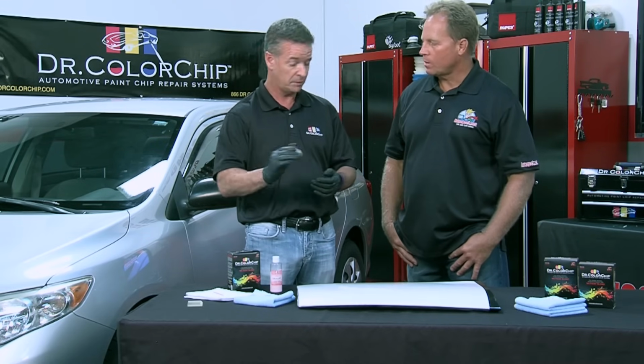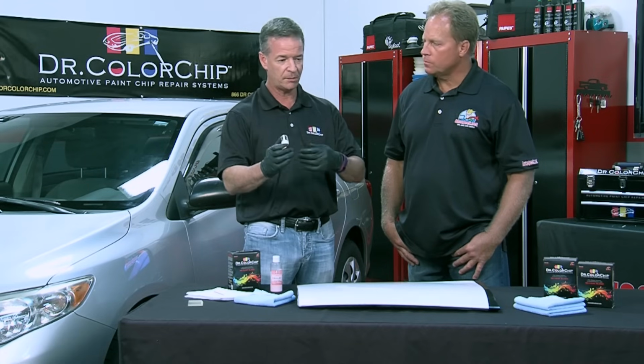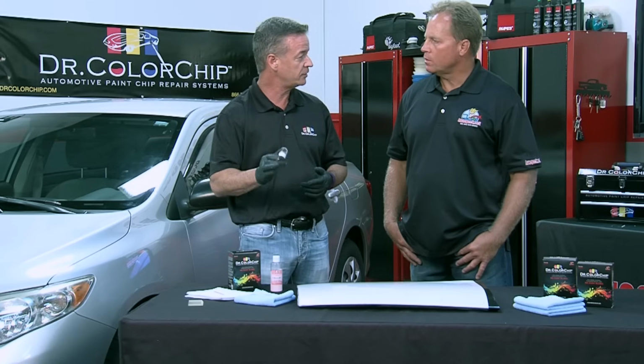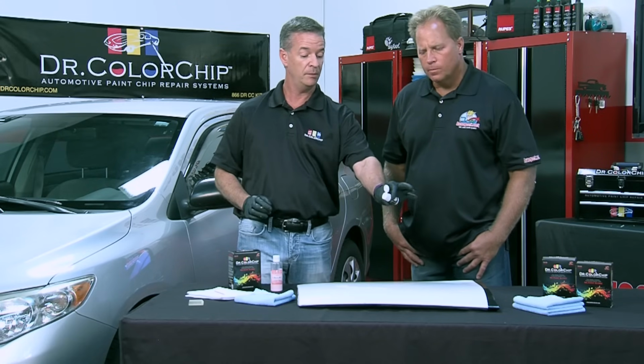And I'm going to go ahead and show you a couple of them here, Mike. When you get the paint, you need to shake it up. There's BBs inside. You want it properly mixed. The pigmentations in the paint will tend to settle, so shake it up for 15, 20 seconds. And then once you're done with that, you can do one of two things. I could flip this top up like this, and I could actually put little droplets of paint on the panel.